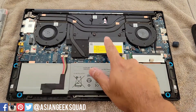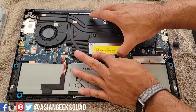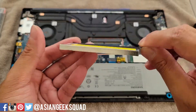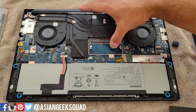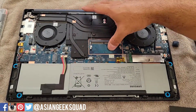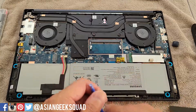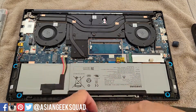Next up, the RAM should be under here — or the extra slot. Just remove the back cover off. There are no screws or anything, just a little sticker here on the side, and you'll have access to your extra RAM slot. With the 8 gigabyte model you do not need to pay extra for the 16 gigabyte, because if you're going to upgrade your SSD you might as well upgrade your RAM as well. For me, I'm just going to add 8 gigabytes so I have dual channel running, and add a second 2 terabyte SSD slot for my files.